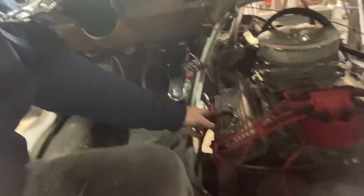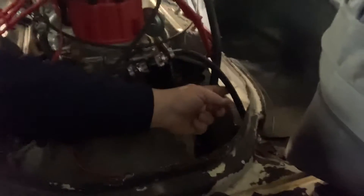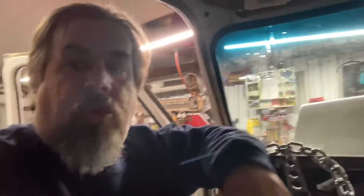They've got a lot of stuff wrong. You need a PCV valve and this hose is hooked to something under the truck — it's supposed to go to main vacuum, the carburetor or the intake port or something like that. I have no idea where he's got that hooked to, but that's wrong. Fuel line is all rubber, going on the back side of the motor, about three inches away from the exhaust. Who would want rubber hose three inches away from the exhaust? That's a fire.